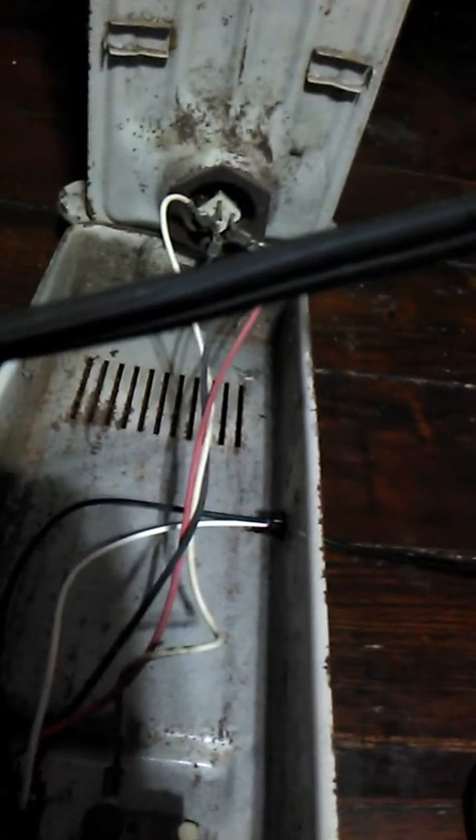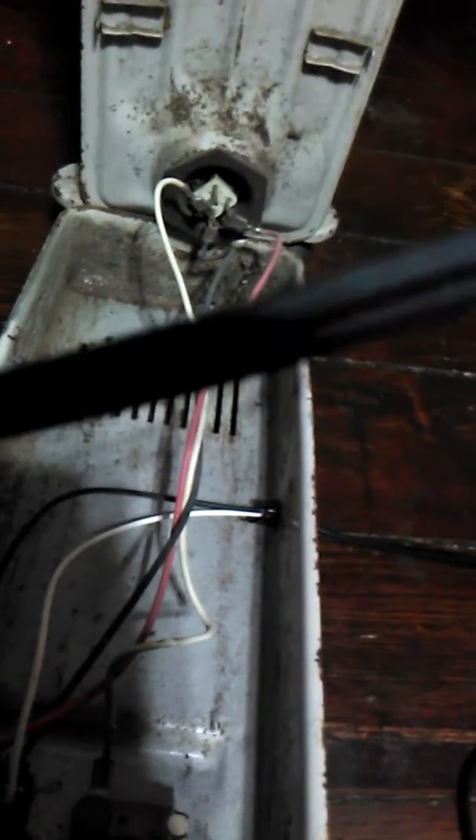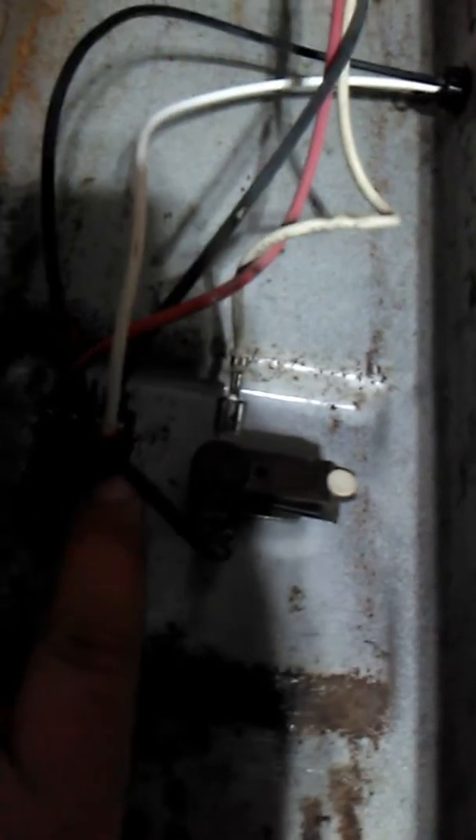On the old wire, you can see the lines on this side — that is the neutral side of the wire. It was plugged in at the top right-hand side of the multi-wattage on/off switch, if you're looking at it from the up-and-down position where it's supposed to be. The hot wire was plugged into the left bottom terminal. All you do is unplug those — they are really hard to unplug if they're as old as this one is, and it's very old.